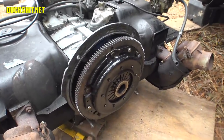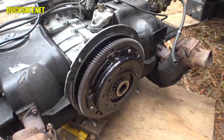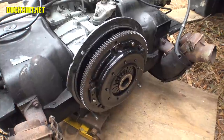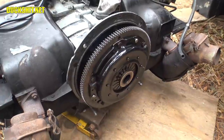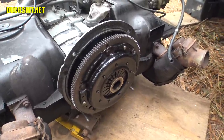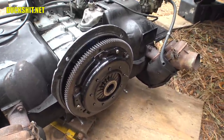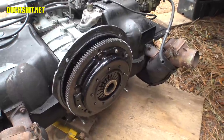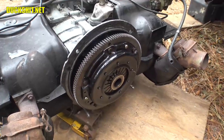As you can see from the sky, it's dreary. Some stuff back here is a little bit wet because things have already started to rain. Wow — nice and oily. I'm going to have to degrease the pressure plate, probably even the clutch. This thing was probably sitting in a bath of oil because the bellhousing would kind of fill up — it does leak out the bottom, but I bet it was holding a pretty good puddle, and the flywheel was slinging it everywhere. My clutch always grabbed pretty good though. It's an upgraded metallic clutch and a stage one pressure plate, so whatever difference that made, it certainly caused it not to slip.